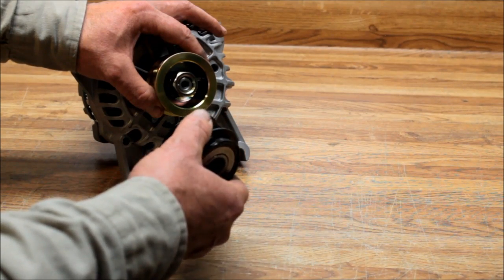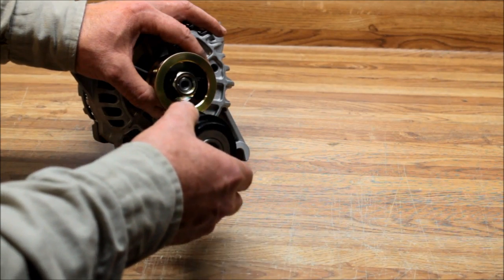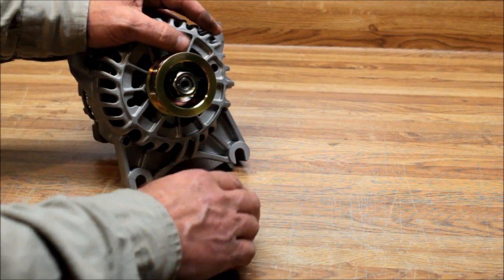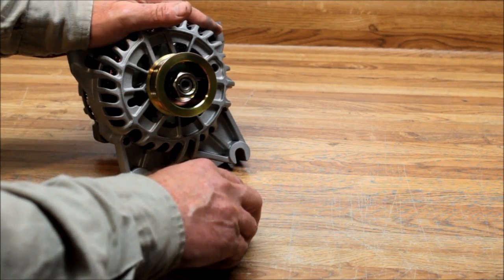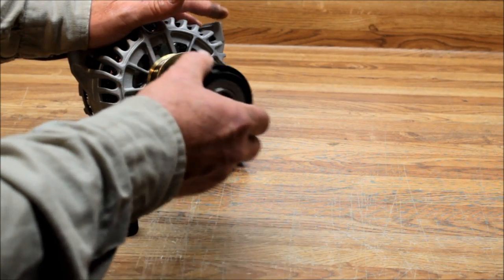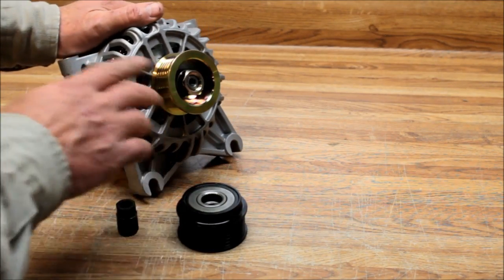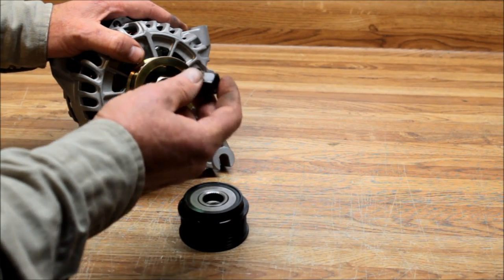They also call them overrunning clutches, so that if your motor slows down and your alternator keeps going, the clutch can freewheel in the other direction. But that doesn't hold water either, because alternators are always under a tremendous load producing power, and when you slow the motor down, that alternator slows right down with it. So it just ends up being an expensive part that breaks. We can set you up with solid pulleys — there are all kinds out there, and you'll likely need a special tool, which we carry.